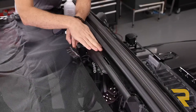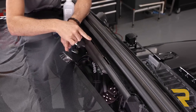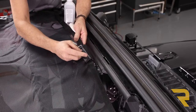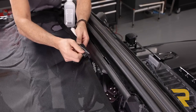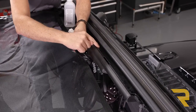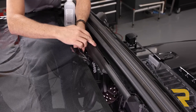Now we're right at the frame behind our windshield — this is the very center of the frame. You're going to notice we've got a couple of little cutouts right here, and this tab needs to be centered in between there. From the factory it's going to have some 3M adhesive velcro attached to it. We need to attach this adhesive velcro to the metal portion — the painted portion of the metal frame. Before we do that, we want to make sure this is prepped well, so we're going to wipe it down with some rubbing alcohol first.